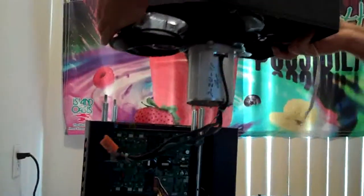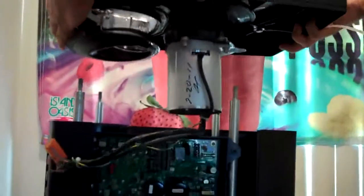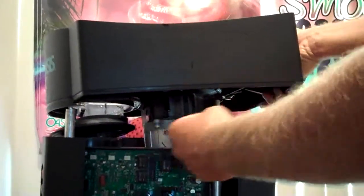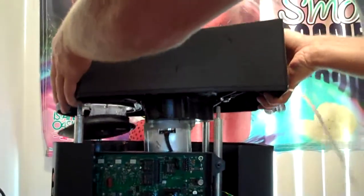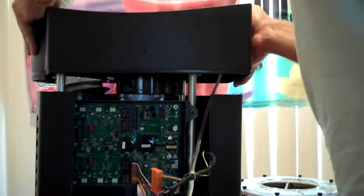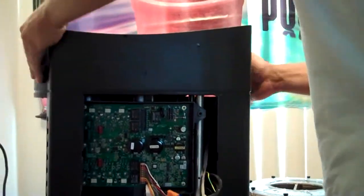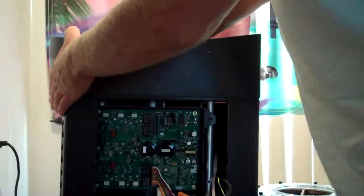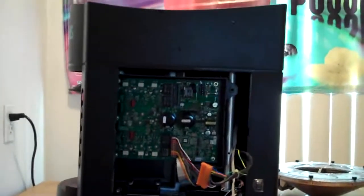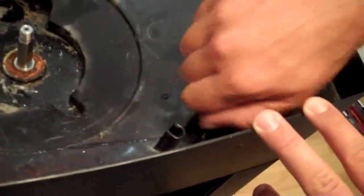Once the shaver motor is securely fastened to the top panel, it's time to replace the top panel by lining up with and keeping the safety switch and the shaver motor lead accessible. We'll start by fastening the bolt on the bottom right corner, and this will secure the top panel to the rest of the machine.